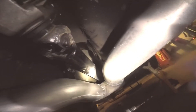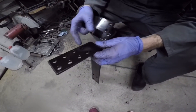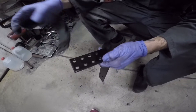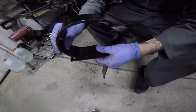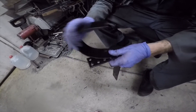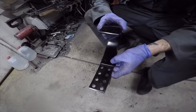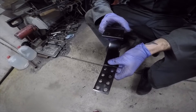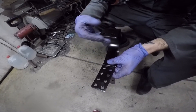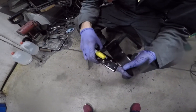It'll be a U at the top and then straight across at the bottom. On the driver's side the upper hoop bolts on right here, which doesn't leave another set of bolt holes for the lower part. So we're going to mark where it needs to mount and drill two holes on this side. We need to make this piece flat and straight across — what we did is we put this on this way first, marked it to make sure there was enough clearance between this and the new plate that goes on the bottom.